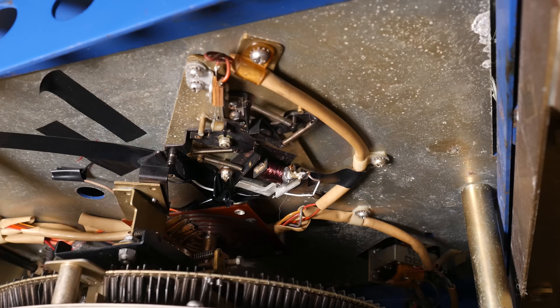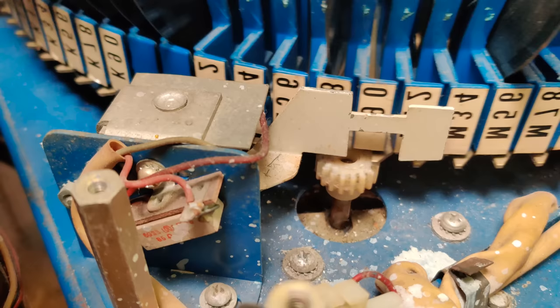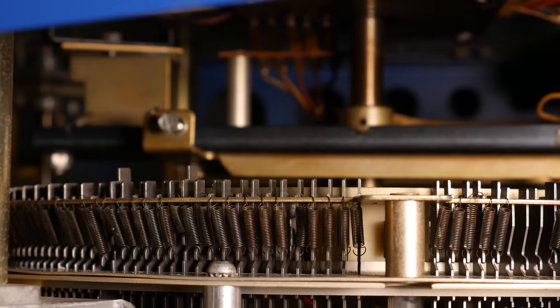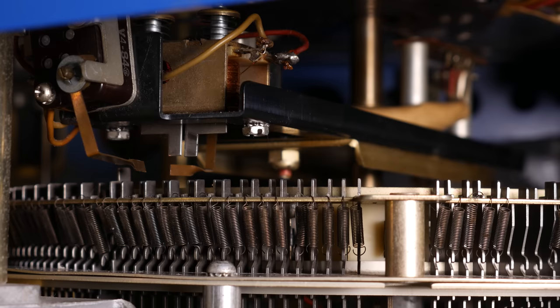But again, all that we had happen was the main power switch closed, so the motor turned on for the carousel to start looking for a record to play. Then the feeler hit the pin, so a relay energized, which redirected power from the carousel motor to this main cam motor. Then as soon as it started moving, we hit the transfer switch to make sure that it keeps moving because we are about to get rid of that signal by pushing the pin back down. And once we've done that, we now have a conflict because two things want to move, but we need to make sure that the carousel motor does not move.